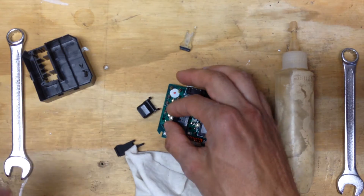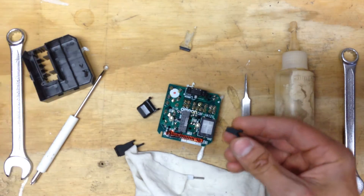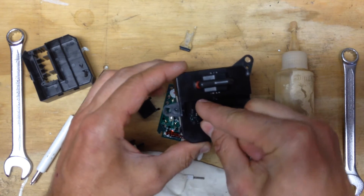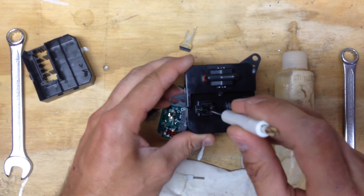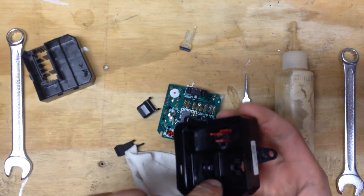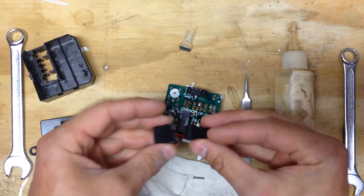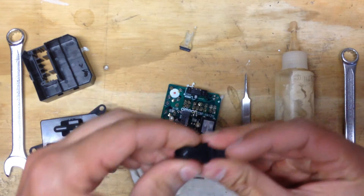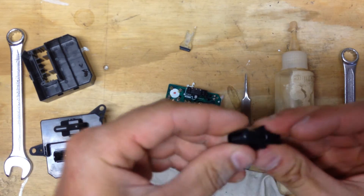So we're going to drop this guy back in. The radius that we've got taken out needs to go away from the passenger window. You're going to kind of just drop this in the top, take your flathead and just kind of push it down. It should just seat right in there. You'll see it kind of sticks out there. The next thing we're going to do is put our new piece in here — this can go either way, maybe flip it around if you want.